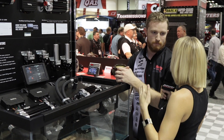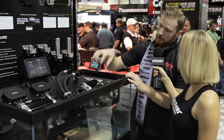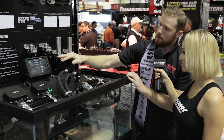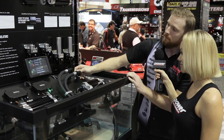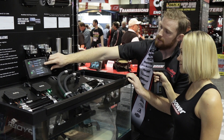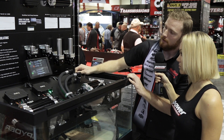Now we're going to compare the old fuel pump to the new brushless fuel pump. We've got our old 12-1800 pump here, and one of these brushless pumps can do the work of both of our old pumps. We'll run that one pump at 60 PSI — somewhere around 58 to 60 — and then we'll turn the 12-1800 on as well. We're running both of those right now, and we're only running one of the brushless pumps. At 60 PSI, this thing is flowing 133 gallons per hour, which is just a little over and very comparable.